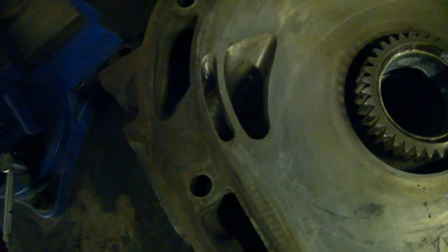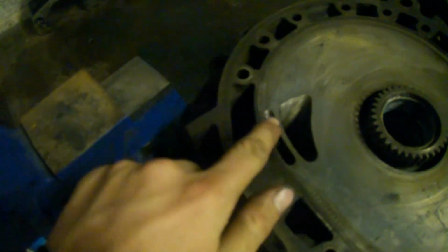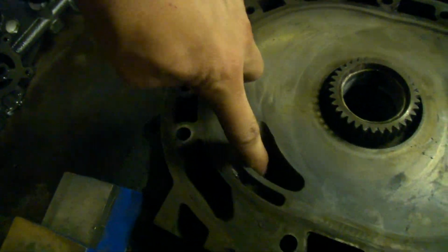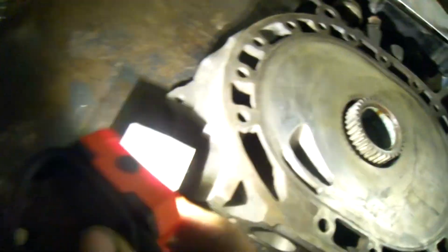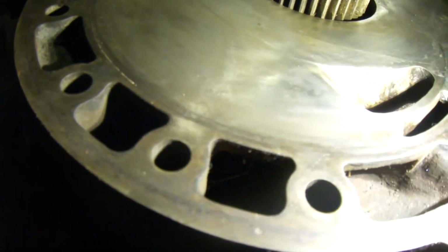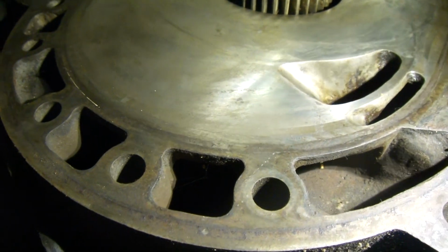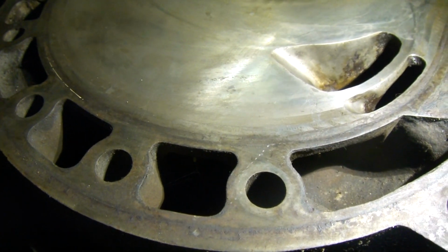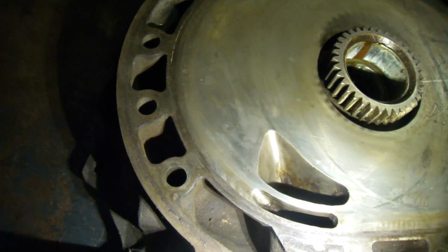So it's very important not to get into the water jacket. Okay, so back around this corner, you can see why this is rounded like that: because back there you don't want to get into the water jacket. Man, that thing is bright. You can see down in there how the water jacket is cast around the port. You don't want to touch that. You touch that, the iron is roached. Can't use it. So that's kind of how that one looks.